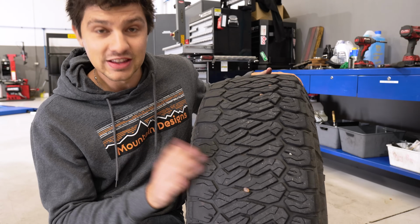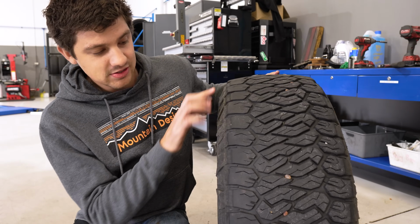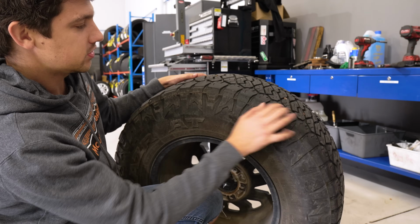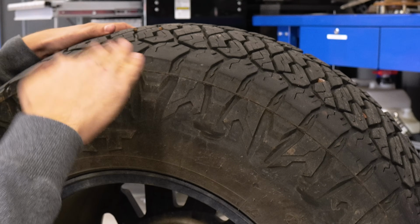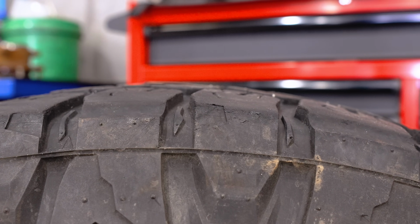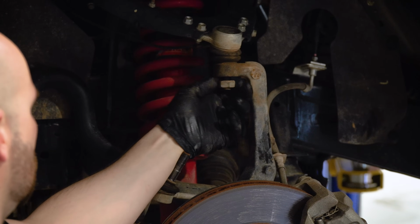You see the tread on the inside of the tyre here is significantly more worn than the outside, but not only that, it's actually quite badly scalloped as well. What that means is if you look sideways, these ridges here are a lot higher than here. It's hard to explain, but if you run your finger around, you can feel it's quite lumpy. So very happy for this issue to be sorted, so I'll stop chewing through these very expensive four-wheel drive tyres.